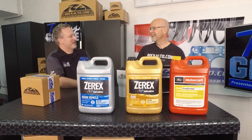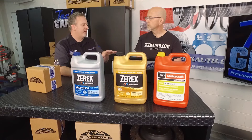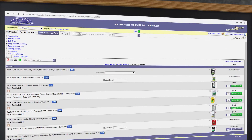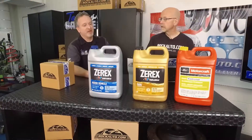It's not that phosphates are bad across the board — it's just that this coolant is right for this engine and this coolant is right for the other, depending on the vehicle and engine manufacturer. Europe tends to have harder water, so they don't want phosphates because they create scale. You can find coolant on rockauto.com listed for specific vehicles, or under tools and universal parts, cooling system, coolant/antifreeze — look it up by vehicle or by brand.